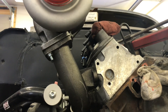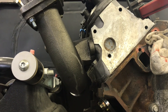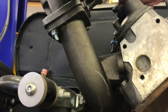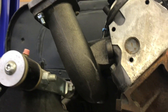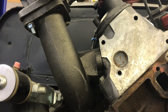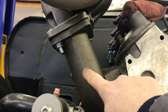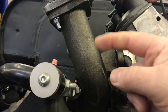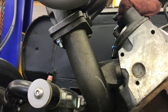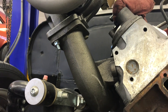I find this situation curious - I'm actually watching another guy do a build with this manifold. I hope it's cast steel like an LS manifold because there's no wastegate here; they put the wastegate in the crossover pipe. That doesn't make sense - you're only venting half the motor. Maybe that's enough to control boost, but in theory it ought to be right about here on the curve with an alternate exit for the most efficient wastegate placement. If I can cut a hole and put the wastegate there, it would work.